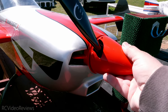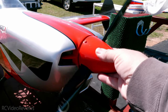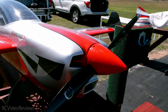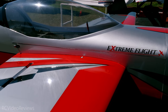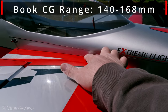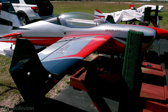One other thing I want to mention is the carbon fiber spinner up front. This came from XtremeFlight — it is $65, 3.5 inches, but it's paint-matched, works with the scheme, and they are very well-made. They're very well-balanced and straight, so you do pay a little bit extra for those spinners, but it's kind of worth it. When it comes to CG, they give you a pretty good range — I think it's about 145 to 165 millimeters. I've got it split right down the middle, right on the spar tube. That wraps up the build recap.